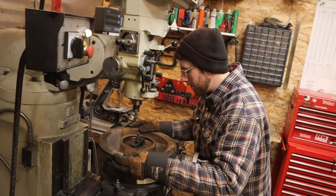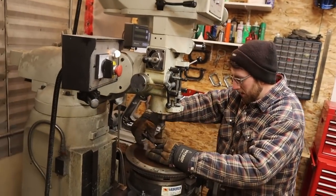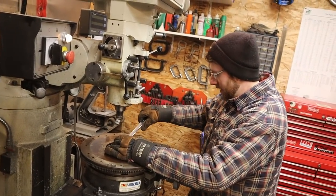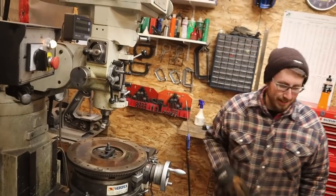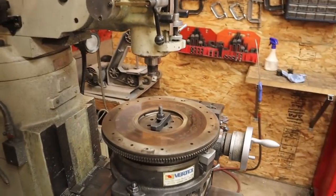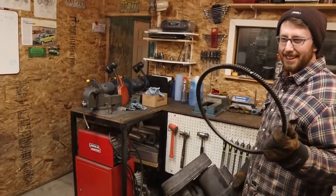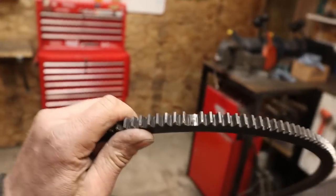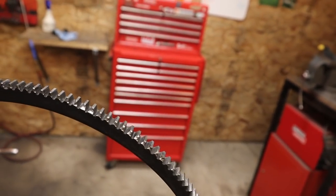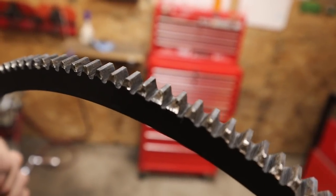The shit work touch-up has kind of turned into a shit snowball. It's quite the shitty snowstorm here. It's gone from the windshield leaks to now we've got the clutch out, spinning the flywheel. It's escalated pretty quickly. Getting a little out of hand. And hey, second gear synchro. Oh yeah, all this green was gear wrecked. That explains the odd noise while cranking over. I thought it was in the starter. There's a few chunkies.